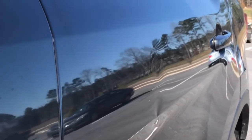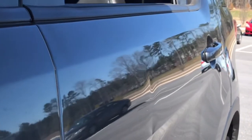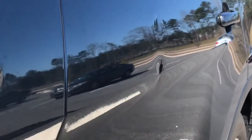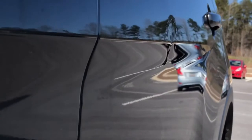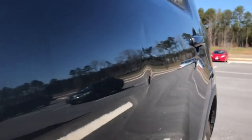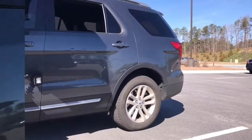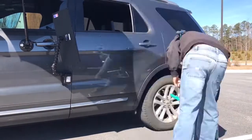So if you look closely at this dent, you can actually see that the metal is knotted up above it a little bit. When the metal gets knocked in, sometimes it displaces out and causes high spots or crowns to emerge above the dents, or below them sometimes. This particular dent on the body line is knocked in pretty deep above, on top of, and below the body line. So it's a very complex dent, a very difficult repair, but we're going to go ahead and show the repair taking place here.